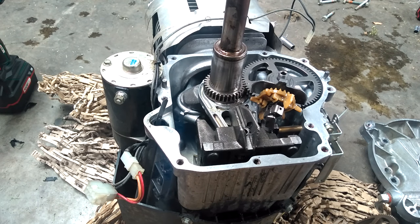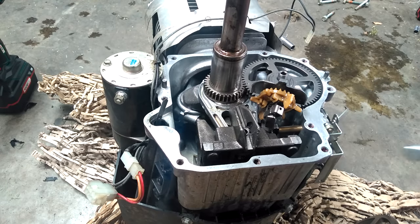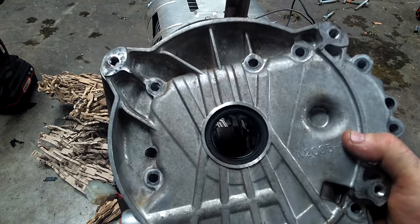It's not as difficult as it seems — you've got four bolts underneath, disconnect your fuel line and clamp it off. You've got to drop the clutch from underneath, but that's just one bolt. Drop it down and then you can turn your engine on its back.